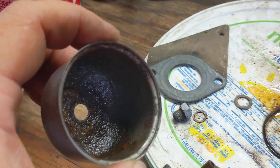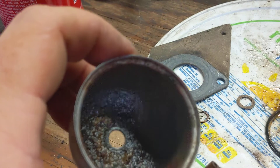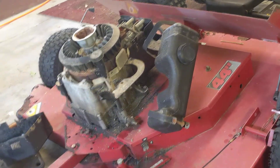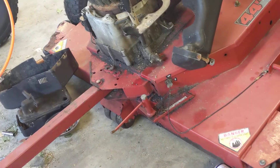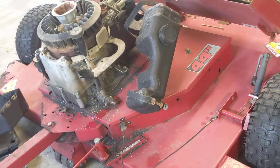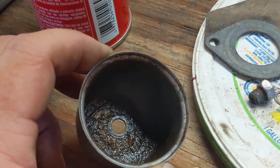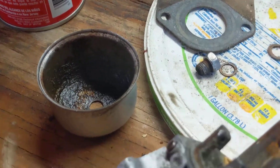This thing has been sitting and water got into it somehow and completely rusted it up. Hopefully the motor is not that bad — the motor does turn over. When I was pulling it I noticed the pull starter wouldn't recoil like it was supposed to, so I took that off and sprayed it with some WD-40 and that's fine now. The motor does turn over, so it's not locked up from water getting down through the carburetor and into the motor.